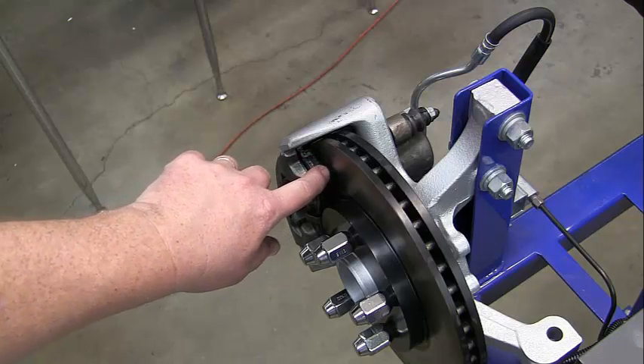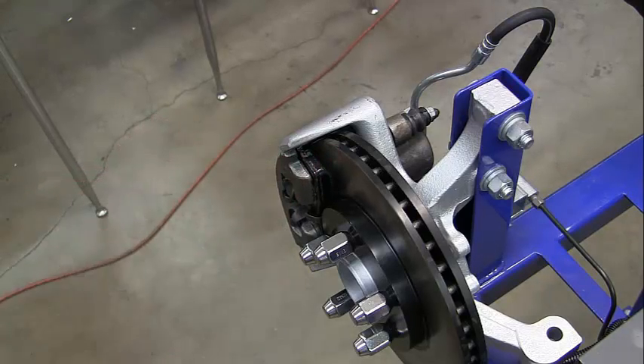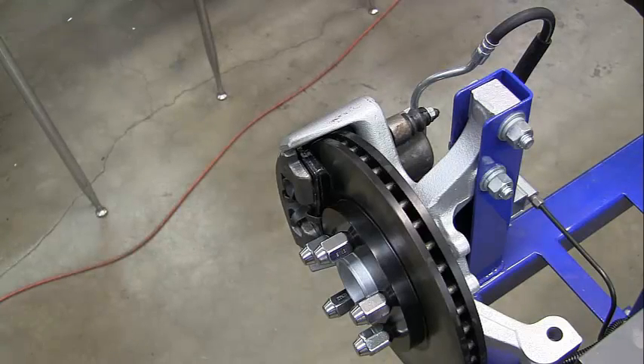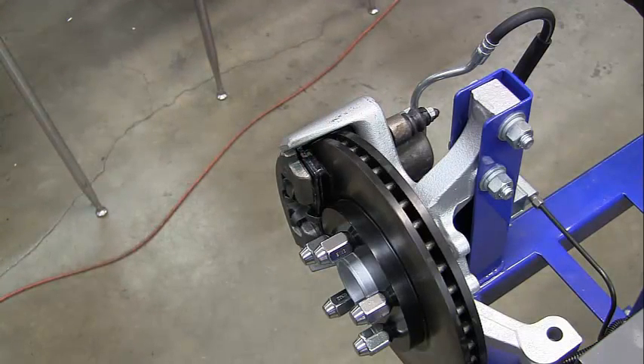Give me an estimate of about how thick the brake pad material is. Once we get down to about a quarter of an inch, we want to replace those pads. We always replace them as a set — we don't replace just one side and leave the other. Anytime the pads are low, we replace both the left side and the right side at the same time.